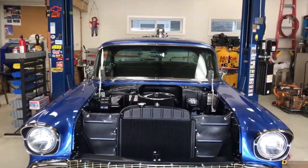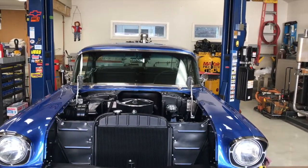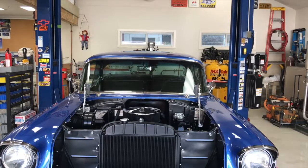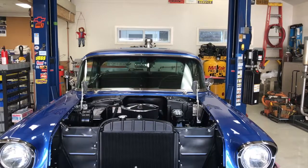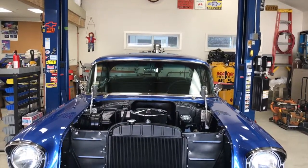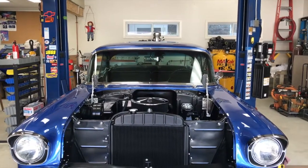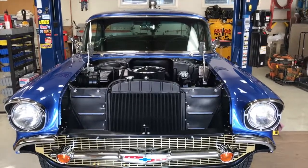The carburetor comes with orange colored springs in the box from the factory. He said, put the silver springs, which are the stiffer ones, which means it richens the mixture. When it loses vacuum and you open the throttle, it richens the mixture right away. Those are the strongest ones. They're rated for, I think, 8 inches of vacuum, and the ones from the factory, I think, are 5. There isn't much vacuum. With the cam, this motor only has 10 inches of vacuum.